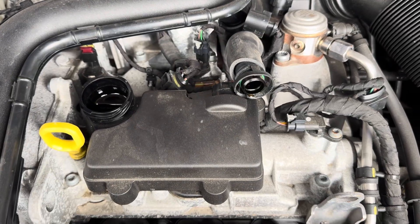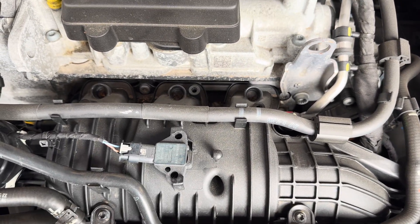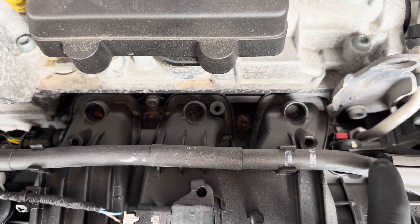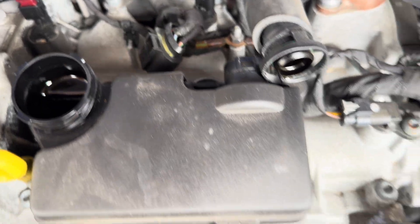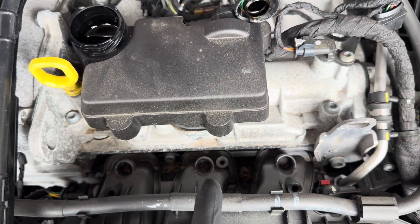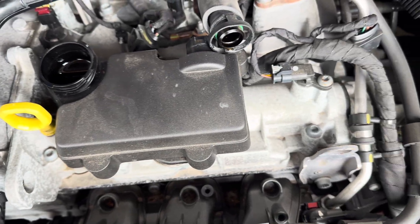Just looking at the car, it's really simple. Inlet manifold at the front, exhaust manifold at the back, got the fuel rail in here, and that's where the plug wells are. We want those ground strap lines to be facing this way — away from the injectors.